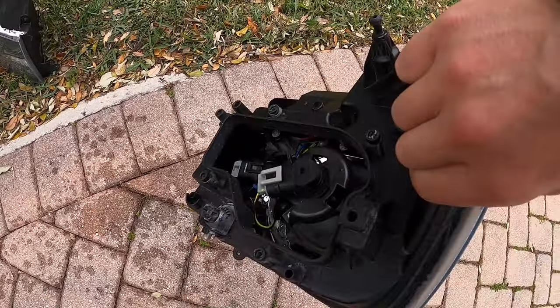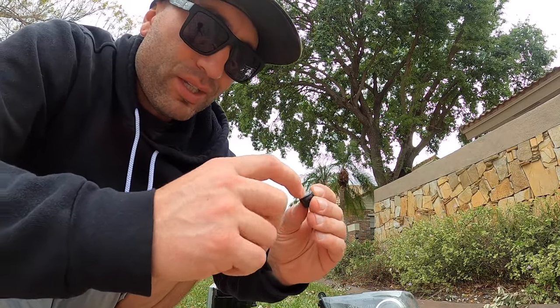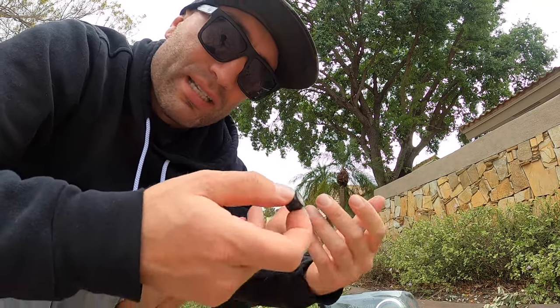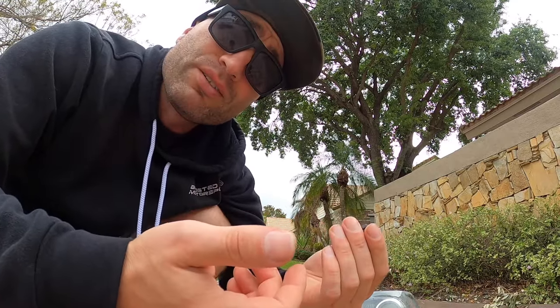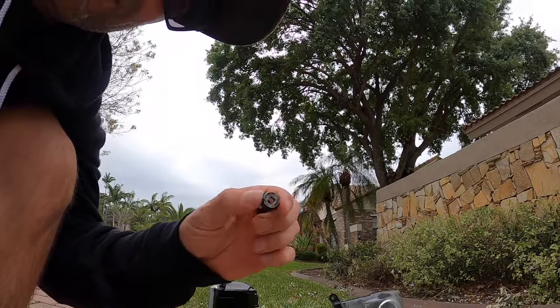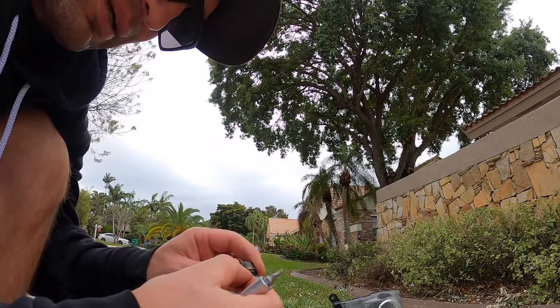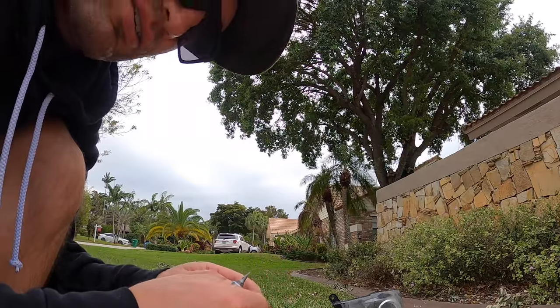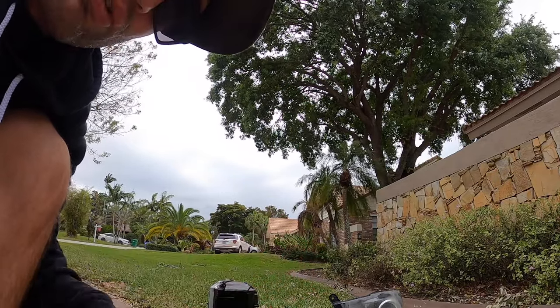That's all water I just dumped out of the back after taking the cap off. I can barely pass air through this thing — it's almost like a wax paper type material. If it can barely let air pass through, how is it gonna let moisture and condensation remove from the headlight? I'm going to remove this cloth paper from the caps because it's really causing the issue. I went ahead and opened up all the paper cloths on these. Worst comes to worst I'll put a little bit of foam in the back later as a filter, but these headlights have to breathe. I'll cap these back up and wait for it to dry.